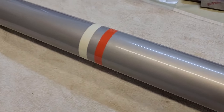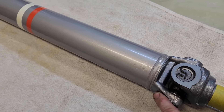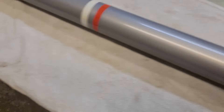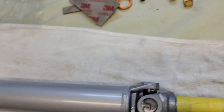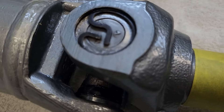We have the driveshaft U-joints in. Our stripes are all base coat clear coated. We also repainted the ends with a cast color — it kind of mimics the factory. Then we scotch-brited the insides of the bores and picked them out, cleaned out everything to make sure it's all nice and clean, pushed them all together and we're all good.